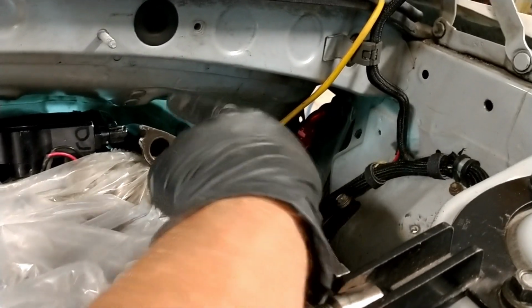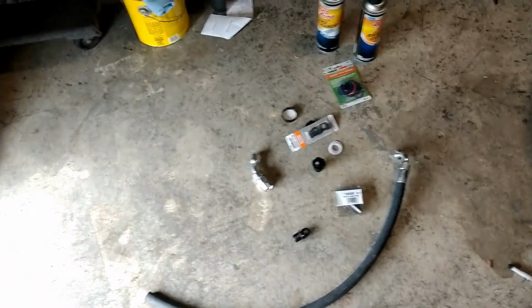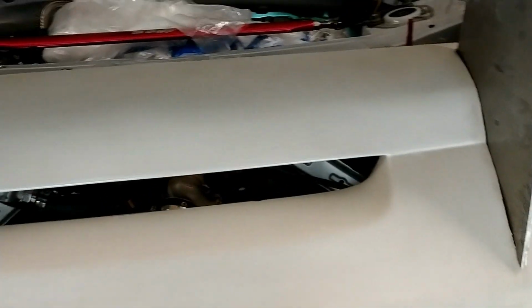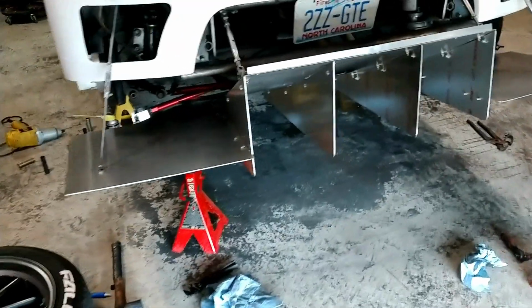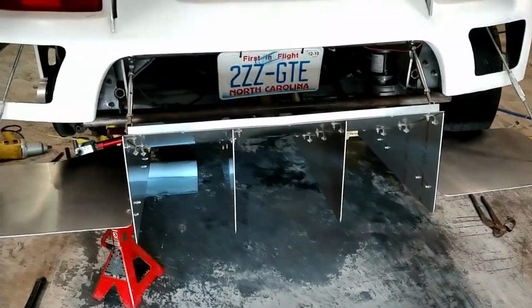So I'll have a catch can over here, and it'll go down and attach to the plate that I'll have the new AN fitting on, with all of that connected to allow the ventilation still to happen, but to get it out of the way, and hopefully even improve it and clean things up, make things a little bit nicer. So that's one of the things that I'm trying to get done here in the next 2 days to improve the car for the dyno.